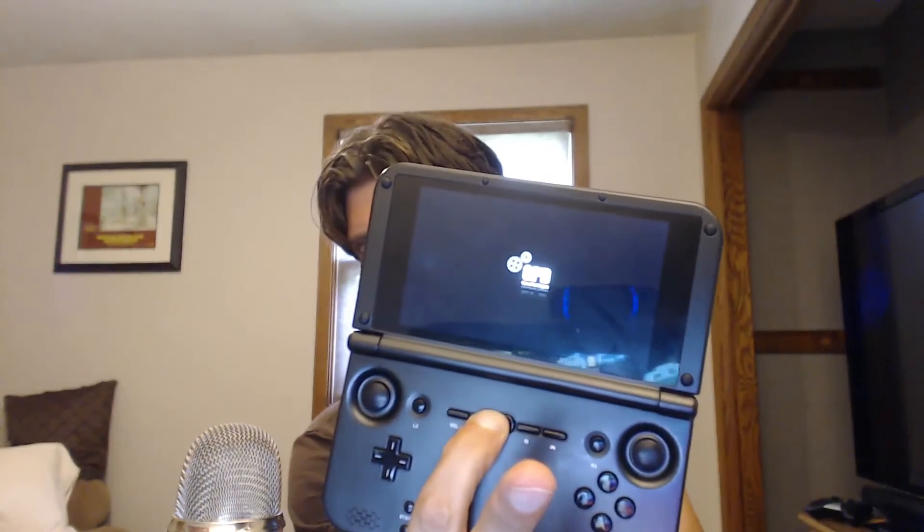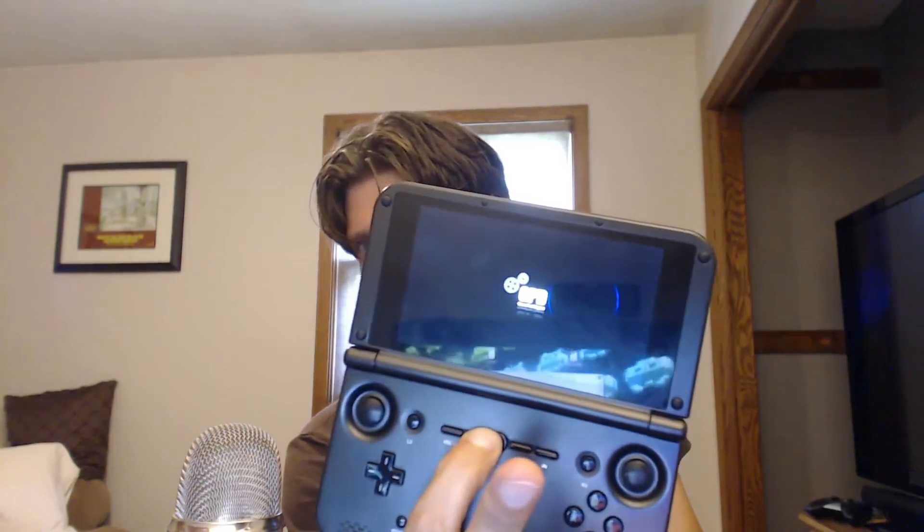So you've copied the IMG file to your SD card and placed the micro SD card into your GPD XD. Now make sure it's absolutely off. Press at the exact same time both the Start button and the Volume Up button — with one finger, like a boss. The screen will come on and in a moment it should enter the Android recovery console.